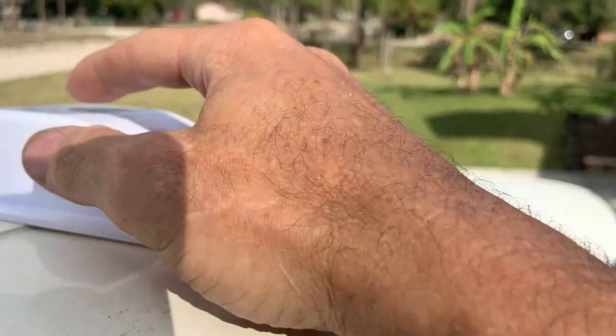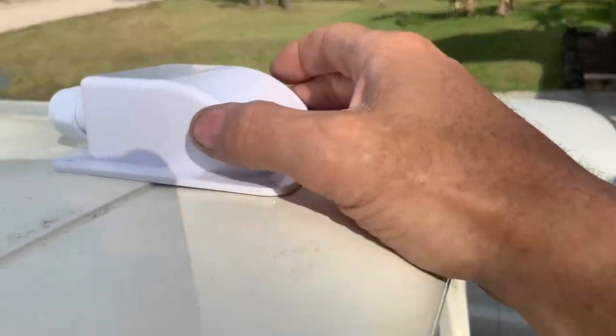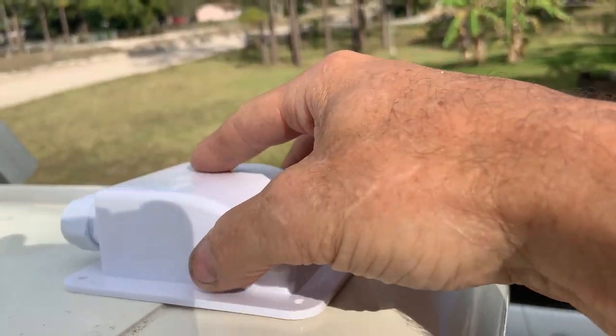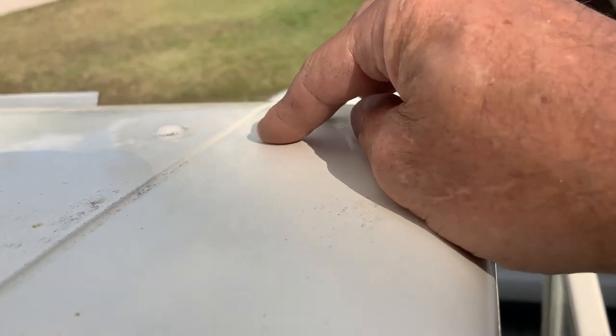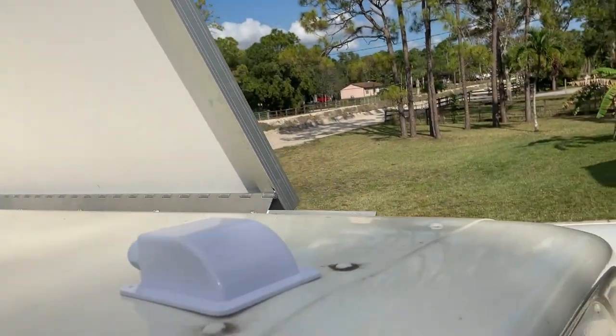So I've got the whole area above this plate that I put in up there — that's blocking off where the warning lights were. You could see the rivets way up in there. I just need to be to the rear of those rivets and I'm in the clear. Here's the cover plate for the warning lights — I just need to be outboard this seam to be away from that reinforcement on the inside. This area behind the seam is just one layer of sheet metal and we're golden there. So right where I have this thing sitting is perfect. What I want to do is use a grommet or two grommets — preferably one if I can squeeze it in that little space down there. So let me find some grommets, so I don't have to worry about the wire rubbing on this metal. We'll be able to get these panels connected today, I think. That would be great — we can start charging off of solar. I can cut my umbilical cord.